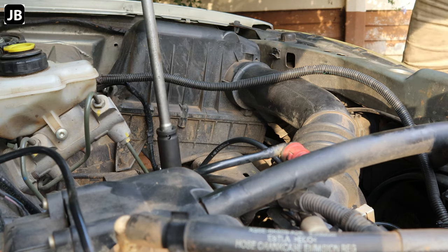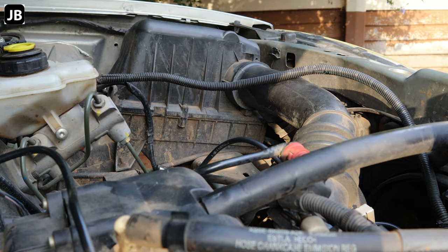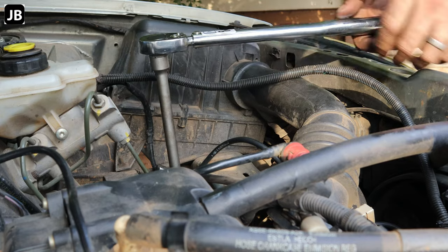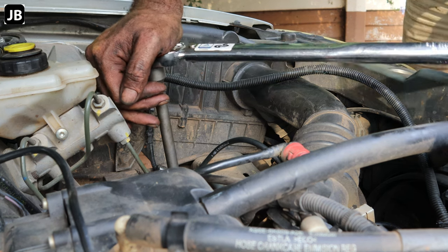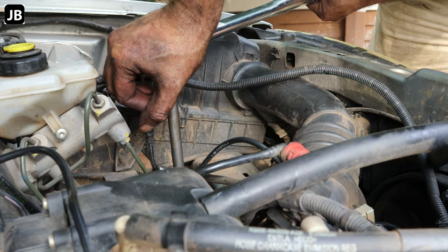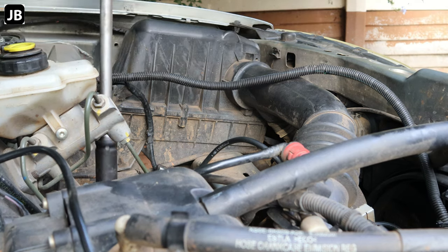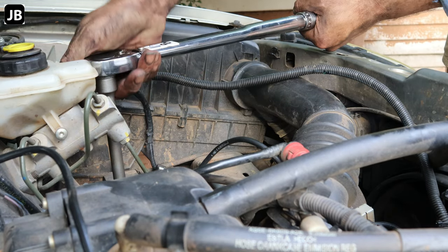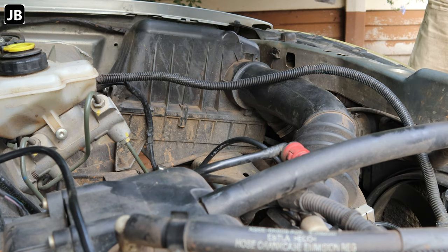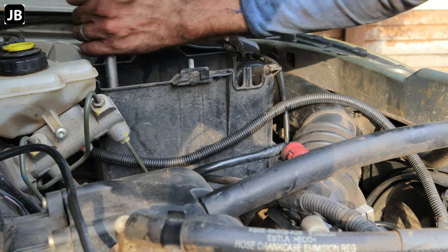Okay, and now we can finally torque the... what's happening here? Torque the transmission mount to 69 newton meters. Battery box. Okay, so and the battery box both 25 newton meters, but I guess you could just tighten them up.